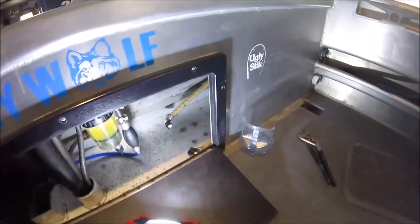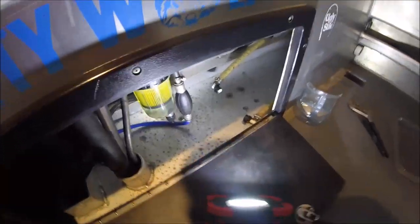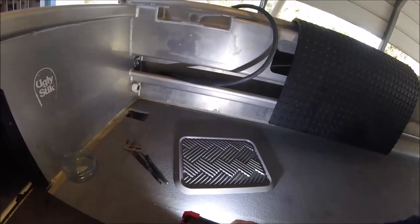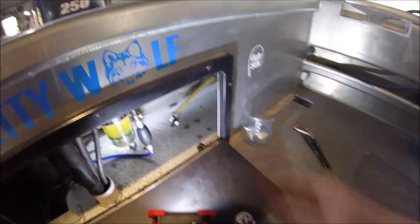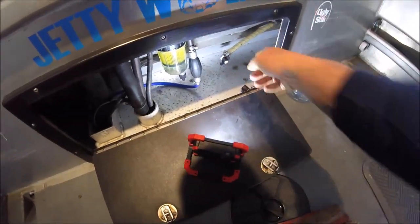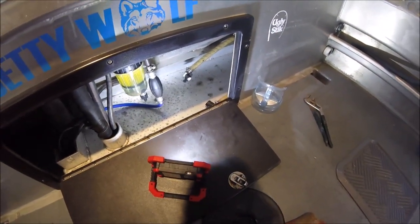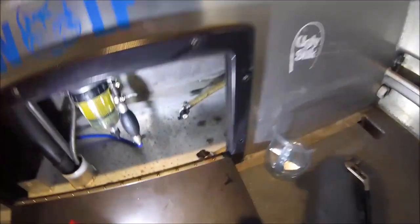What I'd like to do is get rid of that whole setup and be able to throw stuff up in there. I really started to notice a lot of water in here. The pump was sitting on this mat and look at all the water - as I'm running, I don't even have to have the pump on and it is pressurizing the entire pump. This will get all salty and nasty in here. As I'm running down the St. Johns River, that pump is being pressurized by the scoop on the bottom of the boat and water's leaking in. How do I know? I don't - because I'm driving.